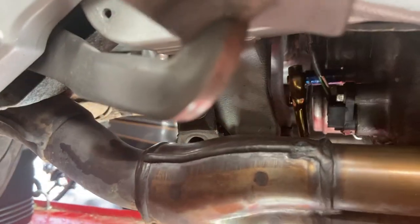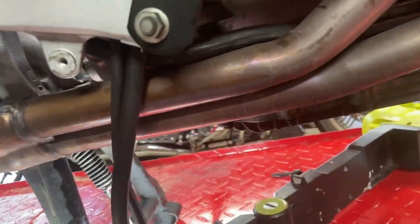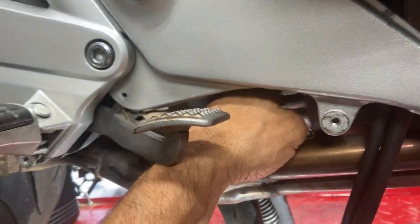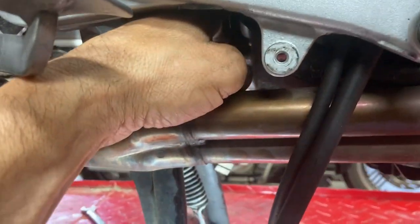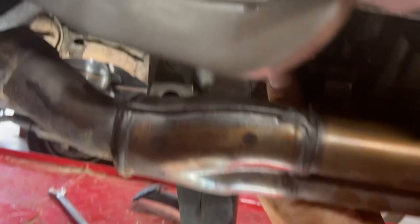Too loose. That's when you want a really fine geared ratchet. Snap-on always asks, you know, 6-point, or do you want a fine geared ratchet or coarse geared ratchet. Fine geared ratchet's good for stuff like that. You only got a short swing.